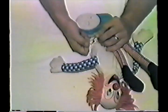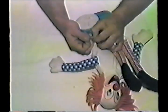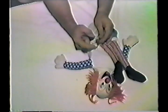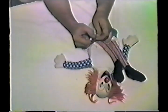Get a firm grip on the string here and then remove it off the Q-tip. You don't want to let the string go or it'll wind up inside the mechanism, and you'll have to rewind the spring and the string once you get it apart.